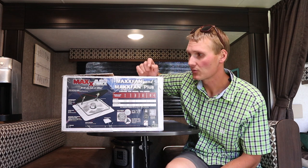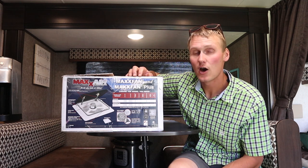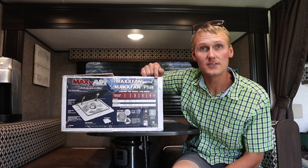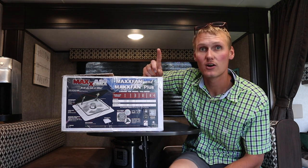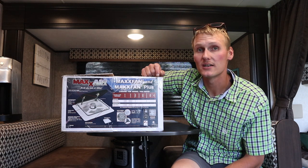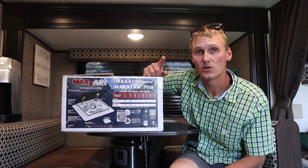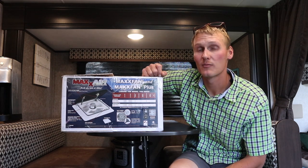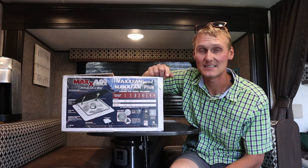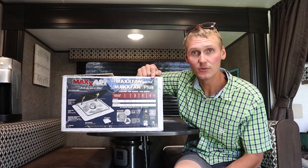This will run on our batteries — I'm not sure how long, but we'll figure that out over the next couple weeks and see how fast it drains them. What we're going to do is wire it into the ceiling. I think the hardest thing about putting this in is going to be the wiring, because our existing vent didn't have any power. So I'm going to go from our LED light above our bed — which always has power and isn't on a switch — and I'm going to wire a piece of wire through the rafters to pull through and hook it to that existing light.